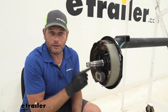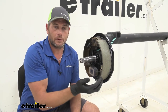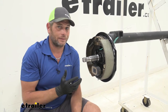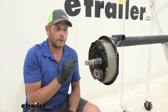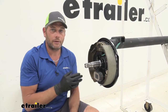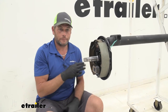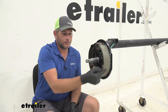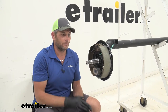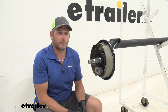We want to make sure that's nice and smooth so there's no way grease can sneak out. I also like to check my brakes — check my pads to make sure they're not crumbling and cracking, make sure there's plenty of thickness, and look at all the hardware for any signs of damage, because this is your best opportunity to change these if you need to. We'll put a part number on screen for a left and right 3,500 pound 10-inch brake assembly. You're putting a brand new hub and drum on, so I like the idea of new brakes to maximize the potential — especially if you had a seal failure with your old hub, because any grease on it is just not going to work properly. Now's a great time to do it and it'll prevent you from having to pull it back off later.